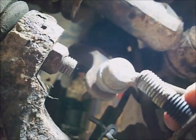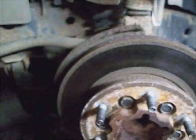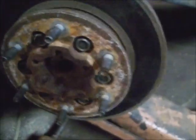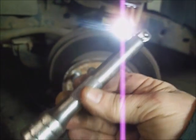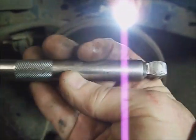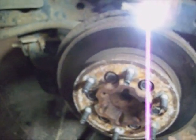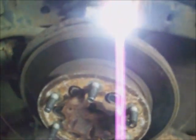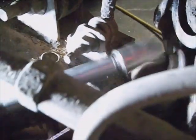It's got some yellow Loctite on them. And I'll go inside and turn the wheel the other way, take the other 2 out. The bottom front one is going to take a longer extension to get past the sway bar link bolt, and I use these wobbler type, give me a little hinge on it. Instead of going straight, it'll be tilted a little bit. The other way would be a ratchet against a socket right against it, and why use that when the impact's available. That's the bottom one. Went like a lamb.